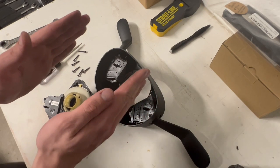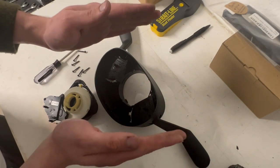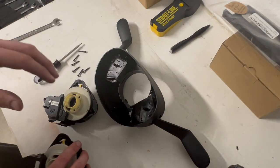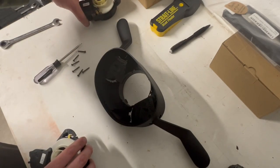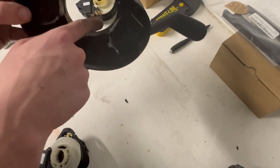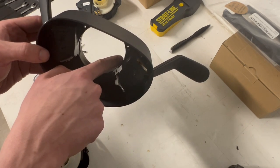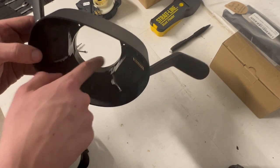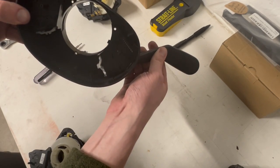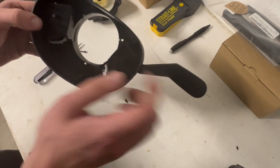When you're taking the steering wheel off, make sure the wheels are straight — it'll be turned about 30 to 40 degrees one way or the other. When you put your new clock spring in there are a few things to look out for. First, make sure the stalks are in the right position. If they're not, they'll be sticking out here — you can see the little nub for it. Make sure the stalks are not sticking out into that area.